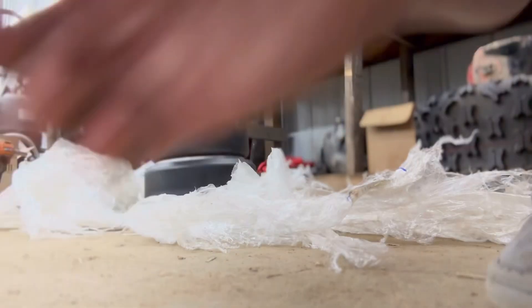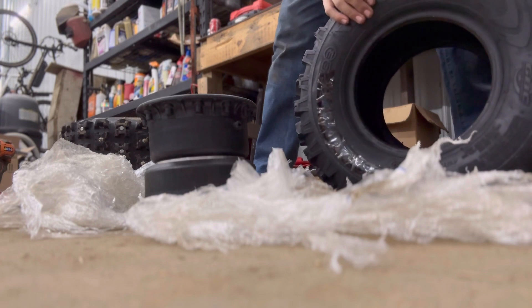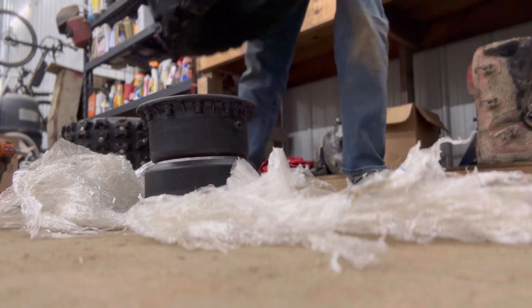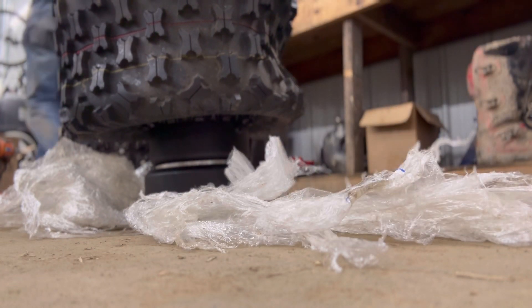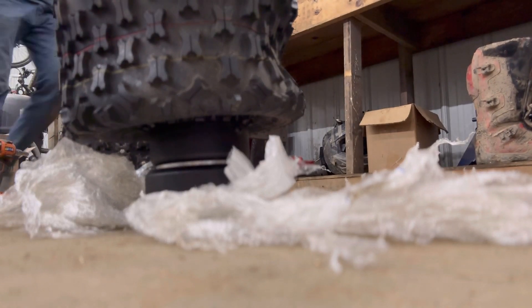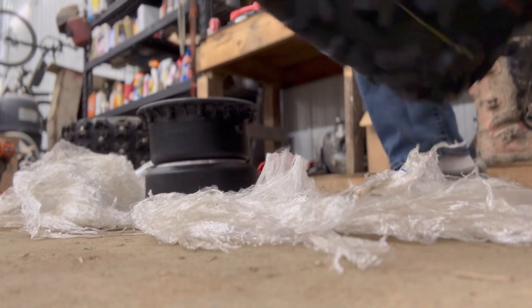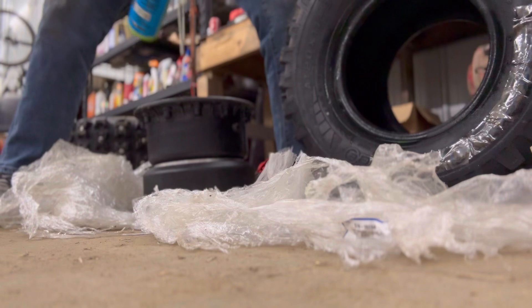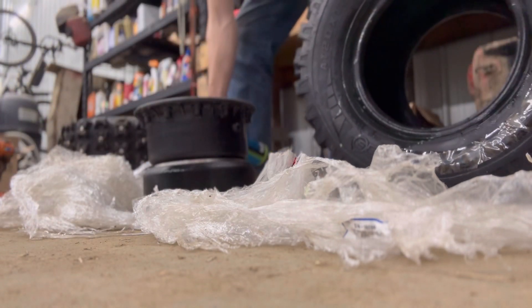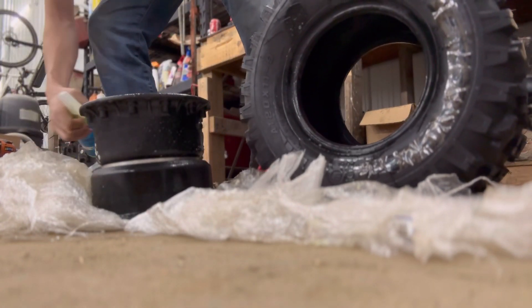I'll show you guys how I put a new tire on. For a new tire, you basically do the same thing just in reverse, and keep track of which side of the tire you want on the outside — you'll put that on the side with the valve stem. Throughout the process, you will need a bottle full of soapy water, just water mixed with a little bit of soap. Before you put the tire on, soap up the bead on both sides of the tire, and then do the same thing on the rim. Be generous with this stuff, it helps a lot.